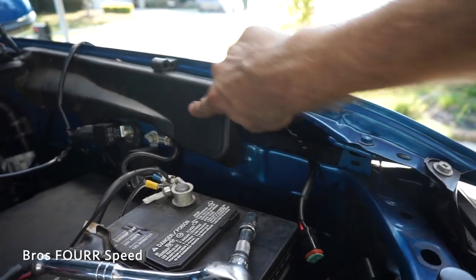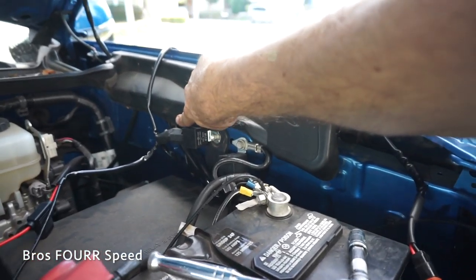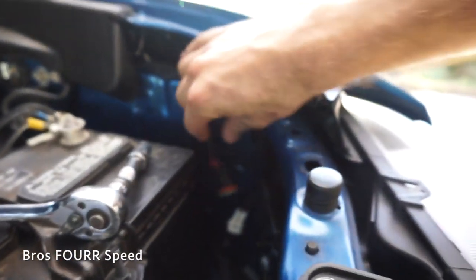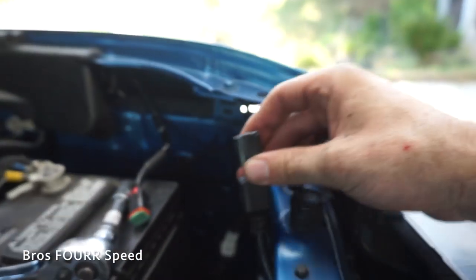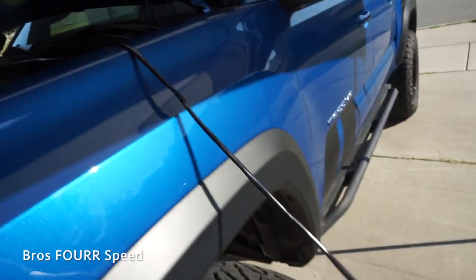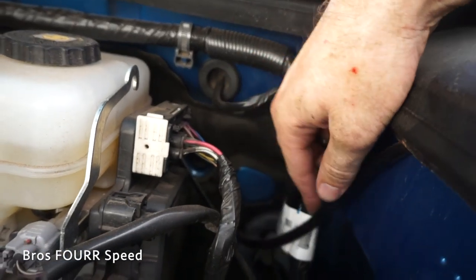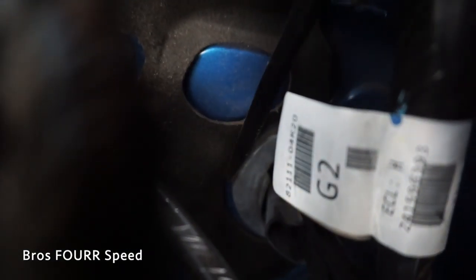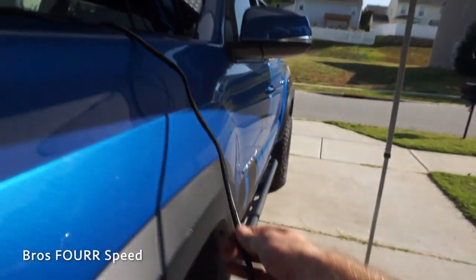I had about five or six feet of cable — it's all hidden behind here, same as the other cable. You can see it all the way up behind here. To clean it up inside the engine bay, you can see it all coiled up right there. The power for the light bar is right here, so I can easily connect these two up and have them kind of hidden to the side. I have all this wire for the switch and I'm going to follow my other cable — you can see it goes all the way behind that grommet and then into the actual cabin. All I need to do now is fish this one through the same way.